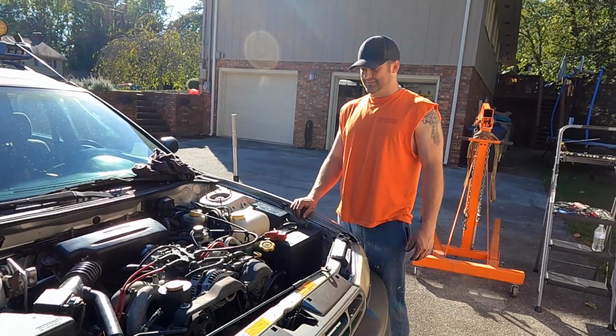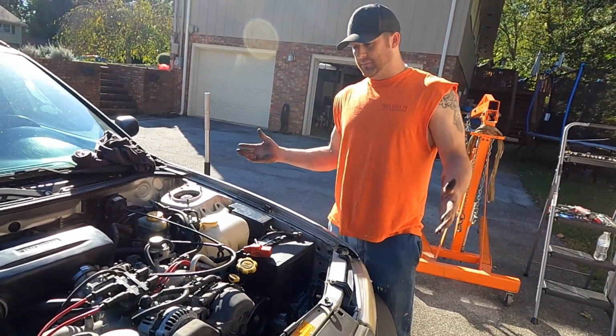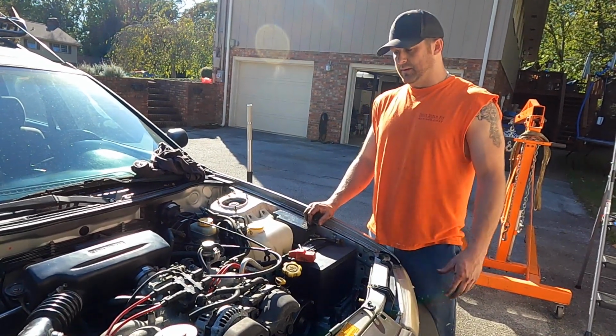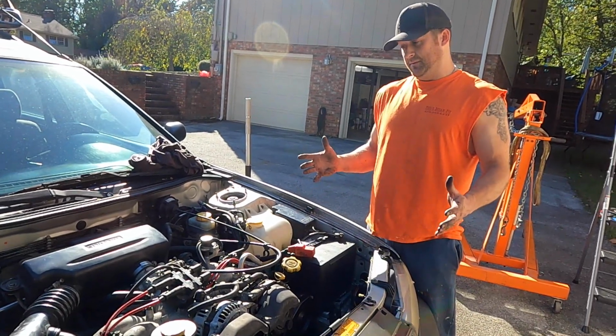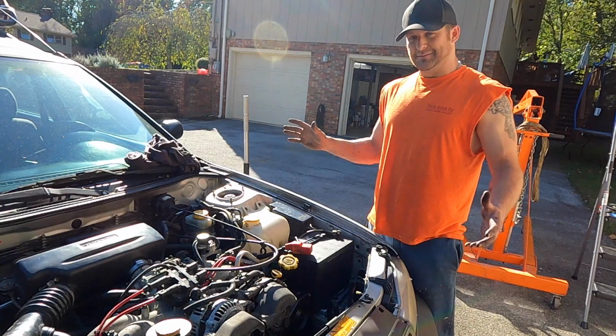All right, give us a status update. Big thumbs up. Compression numbers definitely, cold compression went up dramatically, almost doubled, or more than doubled. So I do believe that was the issue, obviously. So now, for the first time, it's going to start.